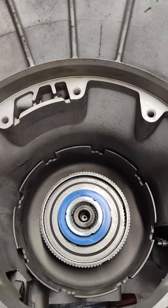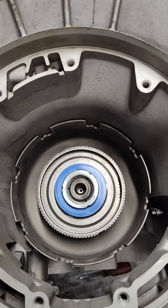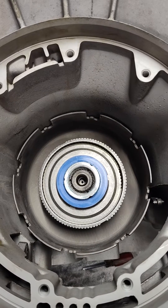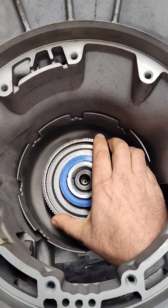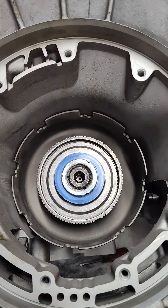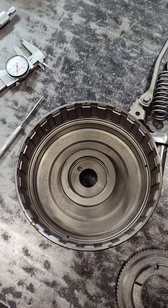Also understand that I've put bearings in this location before — but the thing is, you really don't need a bearing here. This only rotates in reverse, and we don't really care since you're not in reverse much. There's no real reason to spend money to put a bearing there. It can be done if you really want, but there's no reason. This plastic spacer is very simple, very effective — again, only rotates in reverse. The ring gear, when your forward drum is locked on first, second, and third gear, is not rotating. The planet rotates inside of it, but this just stays stationary — so really, all it is is a spacer. It just solves this problem so you don't have to worry about getting another drum. We're going to offer this on the site — we've got a lot of new things coming in 2024, this is just a small problem solver.